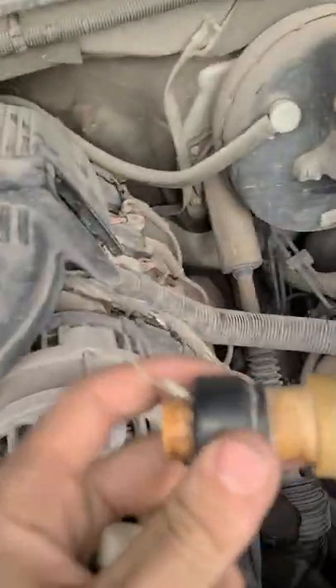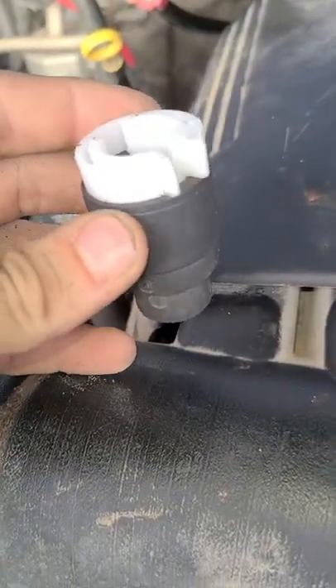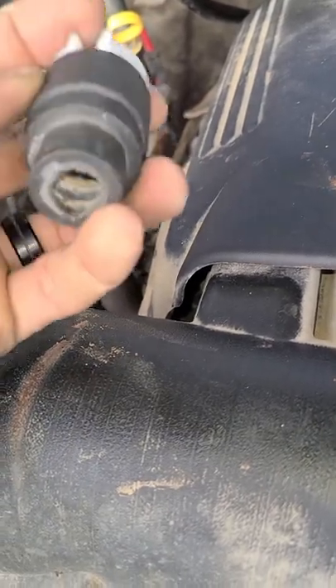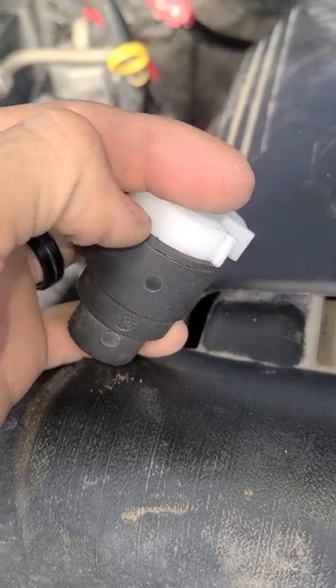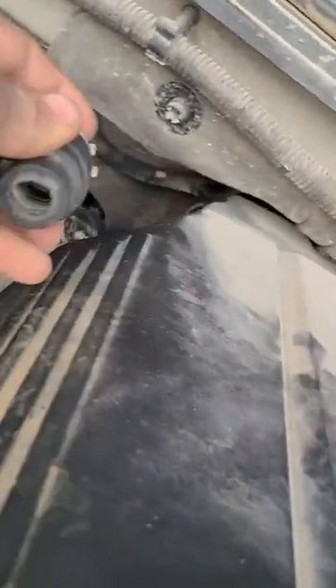This one I had to give it a little tug, but it did come right off when I put that quick connect in the back. But this one here didn't want to come off so easily. So what I had to do — I put this quick connect in there, push it all the way in. Got to make sure it's all the way in. No gaps between the black and the white there. And keep pressure on it while with your other hand, get some needle nose or something and pull it off.